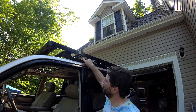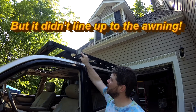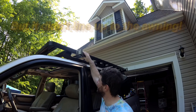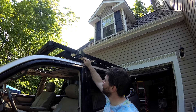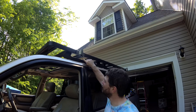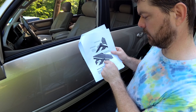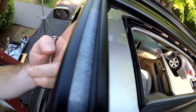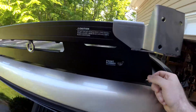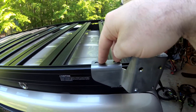For this front bracket, you're going to go through two long bolts — through here and here — so you can move it along, and then this is going to line up pretty well so you can move it back and forth to fit the front of the awning. On the side where your rail isn't, you just have to drill through a thin piece of aluminum. On the other side, you'll have to drill through the aluminum and the rail a bit. The problem is there is a nut inside, so I need to get the rail out to be able to drill through. The bolt is the same size as the nut, so hopefully I can drill through and it'll go straight through the nut and that hole.